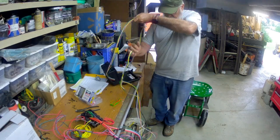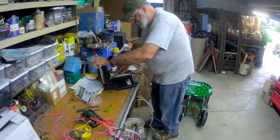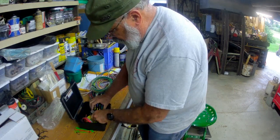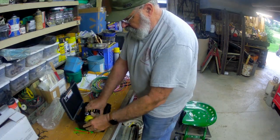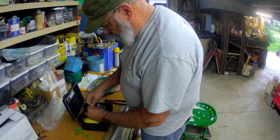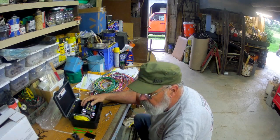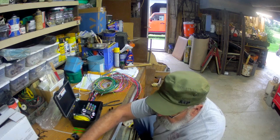One thing I had to do was make my hole a little bit bigger — kind of double wide — and take the grommet out. I'll be able to put the grommet back in, and if there's any extra space I'm just going to fill it with some silicone. At this point most of the wires are through. I've recoiled the individual groupings, and the fuse panel is left inside the box along with some of the extra wires that can be used for potential circuits in the future. A few zip ties keep all the wires neat inside the box. I used the screws they supplied to mount the fuse panel to my box, and then I'll mount the box to the firewall.